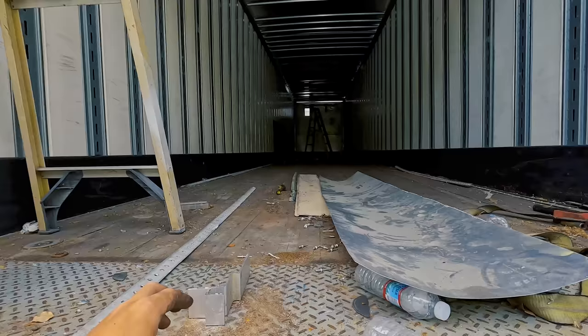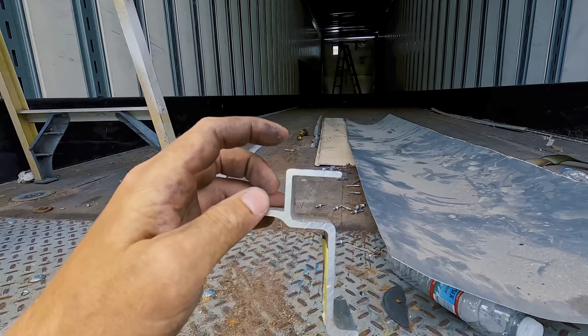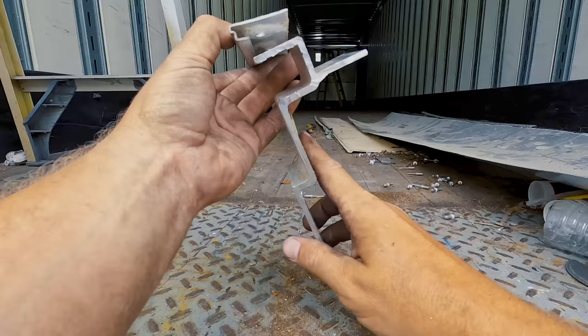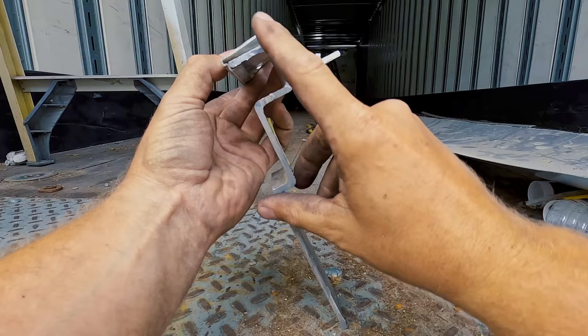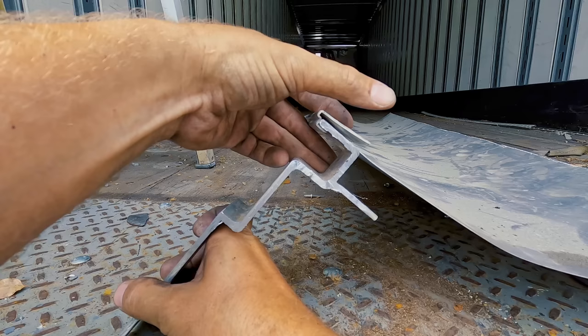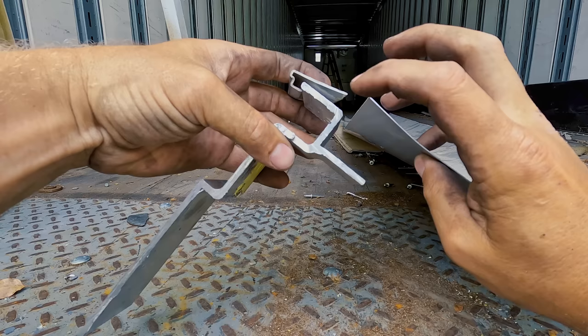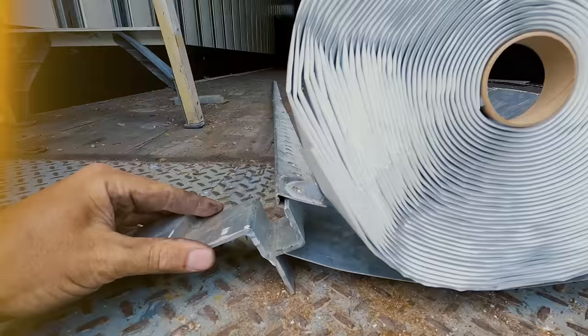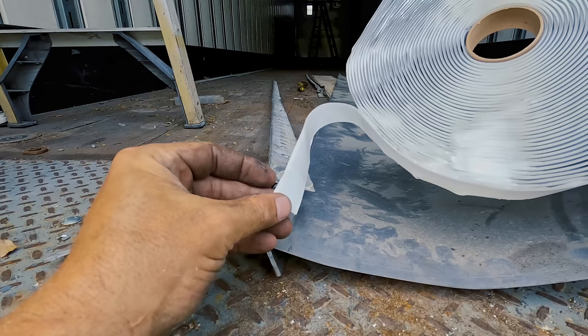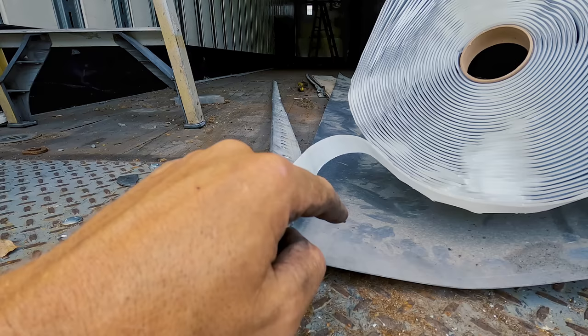Here's a quick example of what this rail on top looks like - the roof lays on top of it. I've got a little piece of rail here to show you: this rail goes on top and then this piece of roof goes right here, kind of like a Tetris-Lego type of deal. In between this aluminum rail and the roof goes this special caulking tape - it's sticky on both sides. You roll the roof back onto it, then put these planks back on, but you have to take this tape off before you start hammer-riveting.